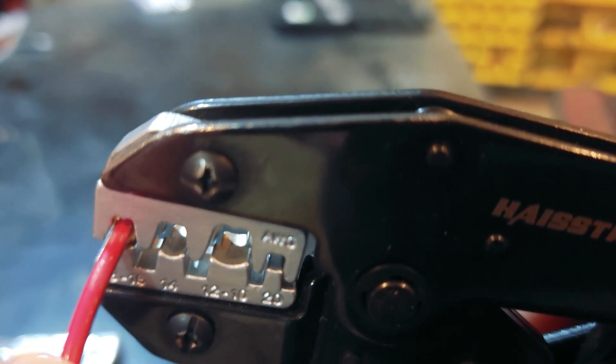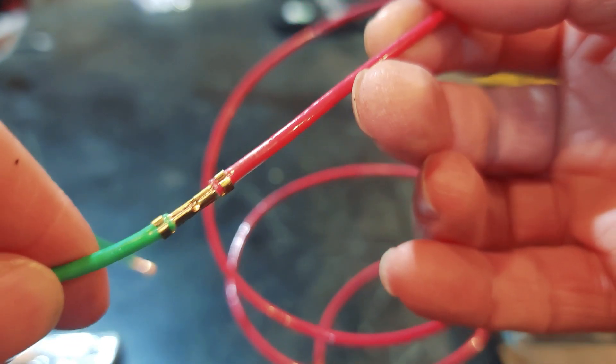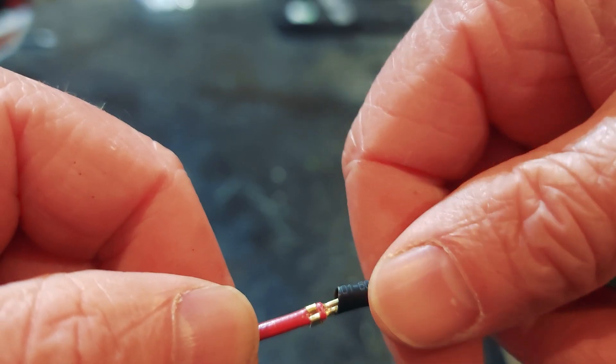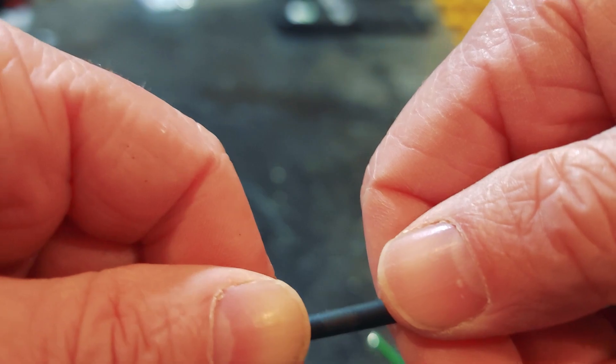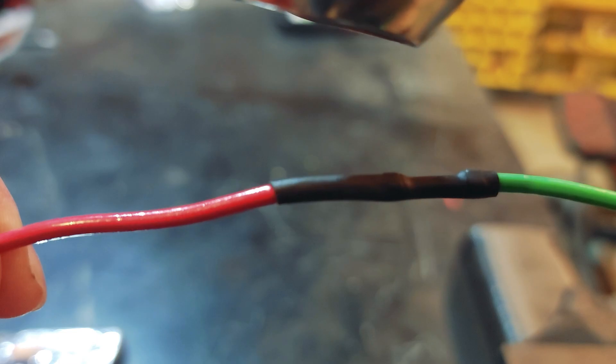In this type of connector we'll do the same with the second wire, completing the very common butt style connection. Once correctly completed it will be a very strong and durable connection. With the addition of waterproof heat shrink tubing you'll have a waterproof, super strong wired connection. The type of crimp matters, and when you get the crimp right that's the same thing the OEMs are using when putting cars together — you can go to your own vehicle and validate that they're not soldering, they're crimping.